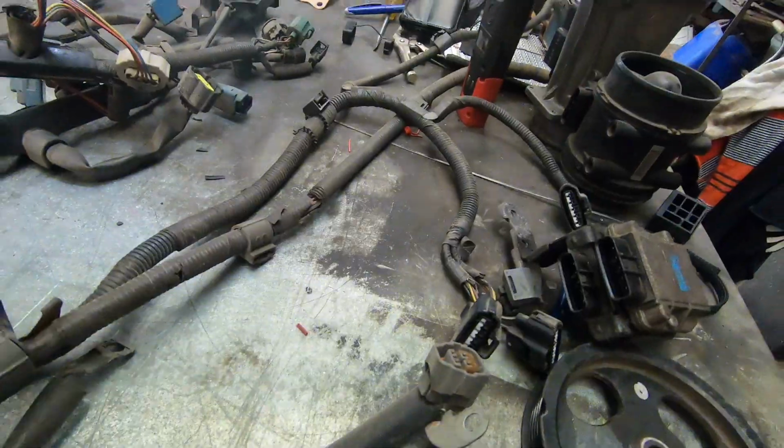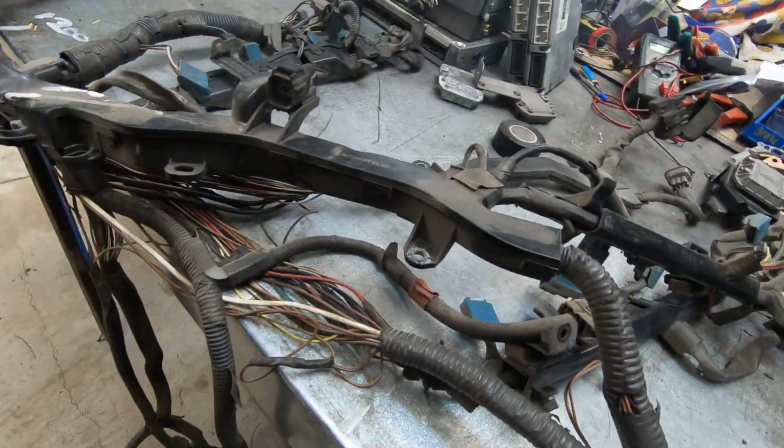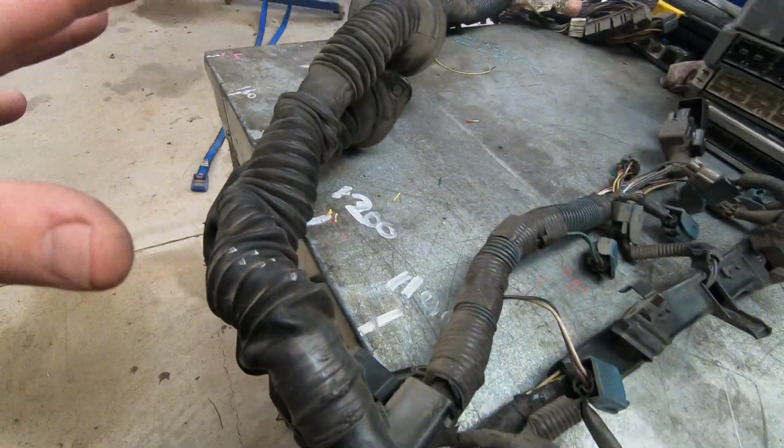And we're going to focus today on the 92 to 94, late 94 ECU, and then the late 94, early 95, through to 97 ECU. And that's the last of the UCF10 and the beginning of the UCF20, non-VVTI. Because I think you're absolutely nuts if you're thinking about running a VVTI ECU on your non-VVTI engine. That's just crazy talk. I've got the two harnesses in question laid out on my bench here.